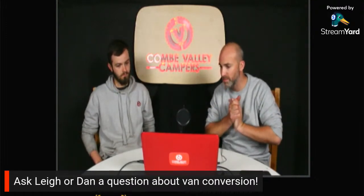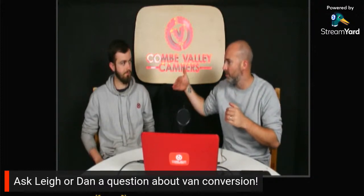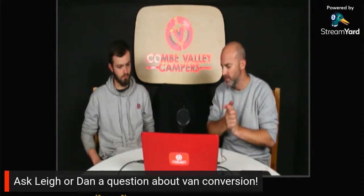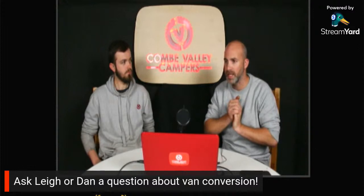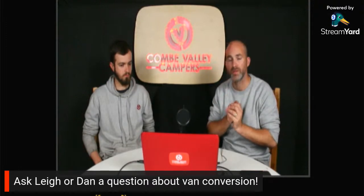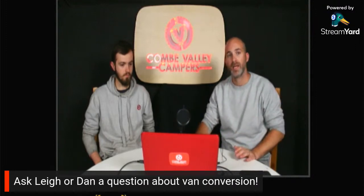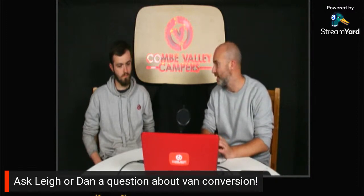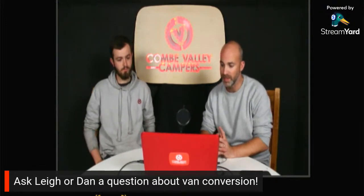T6 and the sound deadening in front of the battery is often soaking wet. I'm trying to think what that might be. If it's sound deadening in the panel behind, which is then the access panel, where you'd run the split charge wiring, unless the join in between your bonnet and the scuttle panel is maybe not creating a seal, so water from outside is getting in. Maybe send us some pictures in an email. You can email us with some pictures if you like at info@coomvalleycampers.co.uk and we can get back to you. Anything like a bonnet bra, maybe it's not on there properly. Yeah, potentially, absolutely.